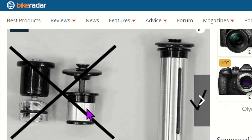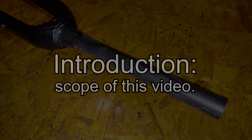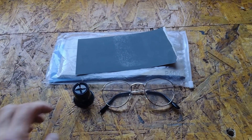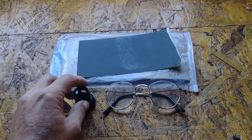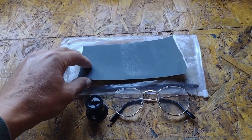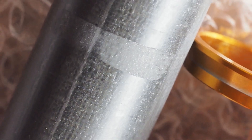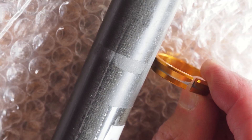It's therefore a good idea to periodically check your carbon fibre fork steerers. In this video I'll look at the top headset region of the steerer only; however, while inspecting this region, it's worthwhile looking at the rest of the fork too. I'll be using only materials, tools and techniques that most people can use at home: some reading glasses, a watchmaker's loupe so I can look close up, and some very fine 2000 grit emery paper. If you don't feel confident or have any doubts about what you're seeing, seek professional help.